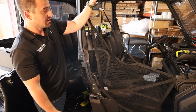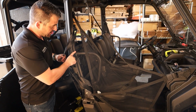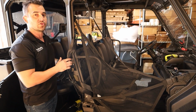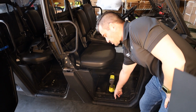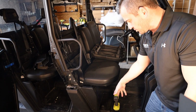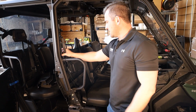we need to go ahead and remove our net, all the fitting points in the net, and then install our new upper shoulder bracket like we did on the rear doors. Now we've taken all the net off, we've reinstalled these 2 bottom ones down here too, which you also need to do on the rear doors just to hold the plastic in place. So now we're going to undo this shoulder bracket and replace it.